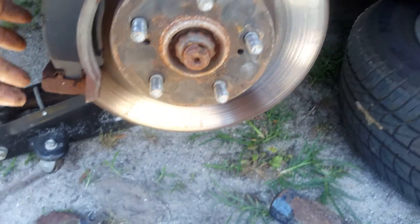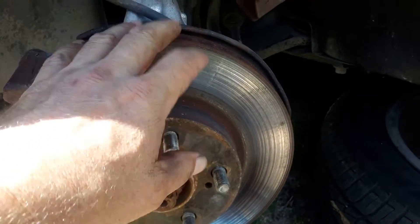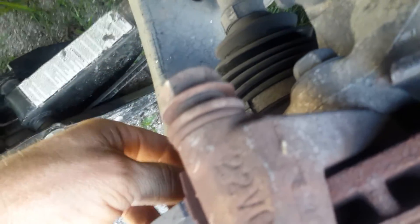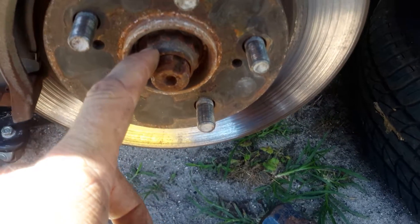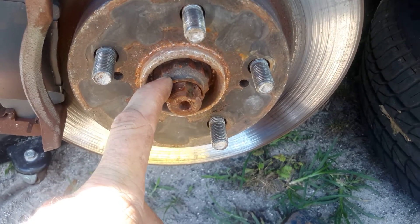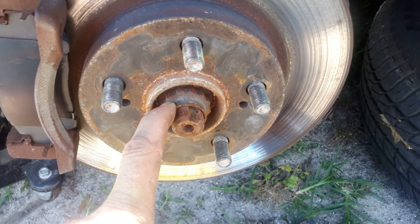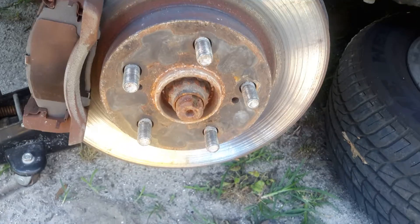This bracket doesn't have to come off — unless, like me, you can see all these grooves where the previous owner just drove the crap out of it. If you have to take this off, then it's going to require taking the axle nut off and the caliper bracket bolts — this one here and this one down here. Unbolt those, pull this bracket off. For the axle nut, it's best to break that one with the tires on. Even if you have to put the tire back on and lower it back down on the ground, you're going to be better off — you might collapse your whole vehicle because of all the torque required to get this bolt off. Unless you've got a nice impact gun, and kudos to you.